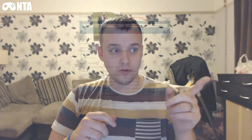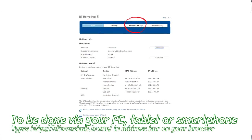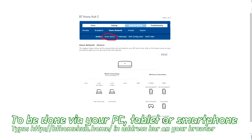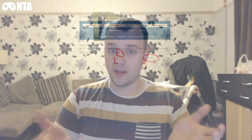The pictures you're going to see now are how to disable Smart Setup completely. Using your router's admin login, go into Advanced Settings and then login, click on Advanced Settings, go to Home Network, then go to Smart Setup, set Enable to No, and then click Apply — so that any new devices you get don't need to be Smart Setup enabled.